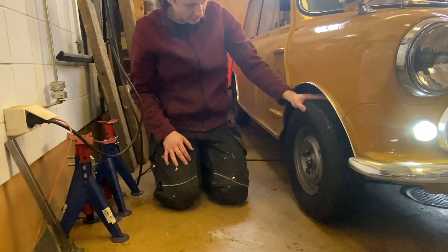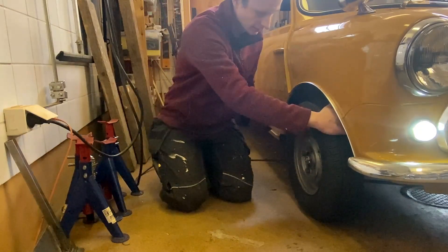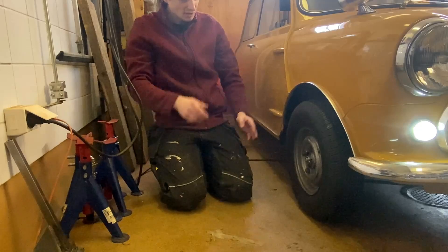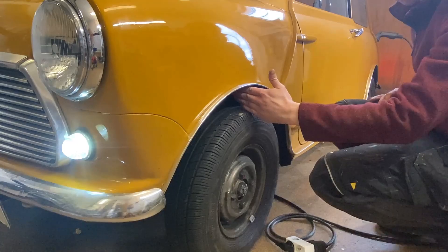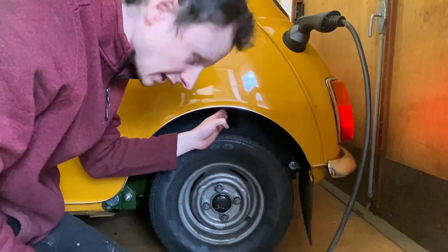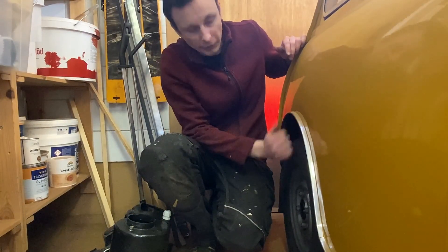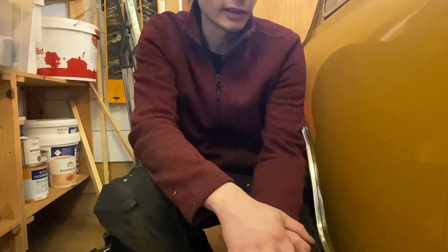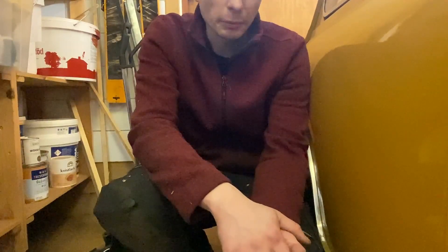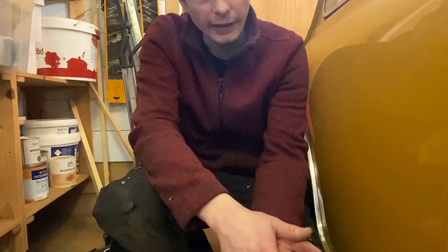In order to make the car ready, I've dropped it on its wheels and tuned the suspension quite manually, almost by looking at it — the steering angles and the right height. You have about four fingers of clearance in the front on both sides, and four and a half fingers in the rear on both sides. I'm expecting the car to drop a little bit after standing on its rubber for a few days, so I'll probably have time to adjust it once more before the exhibition.